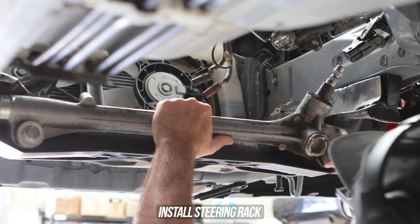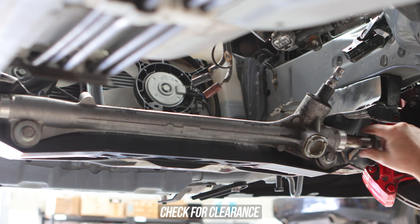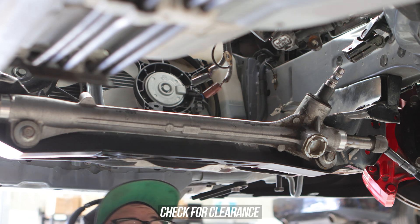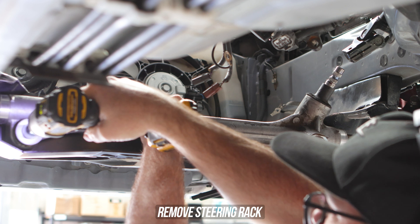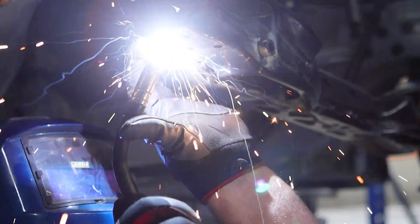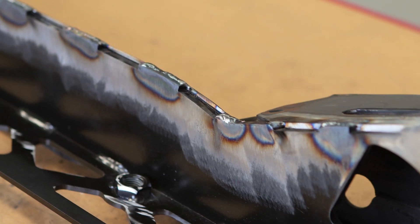Now the first step after the welds have cooled is fitting the steering rack back up into place, then torquing the main bolts down to the specs shown on the screen. The reason we're doing this is because depending on the model of rack and subframe, you may need to trim around the pinion housing as it may make contact. As you can see, we're currently feeling around our steering rack for said contact — if there is none we're in the clear, but please make sure to check this as it is very important. In our case it cleared, so we can remove the steering rack and get to welding this sucker into place for good. Shield your eyes while this guy hopefully lays down the nicest beads you've ever seen. What you're looking for is nice and deep penetration and discoloration of said steel.